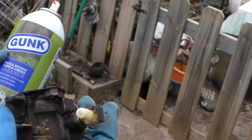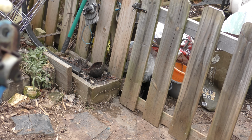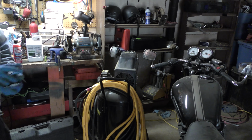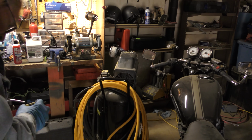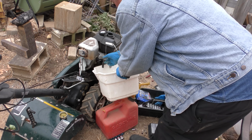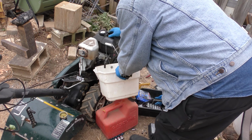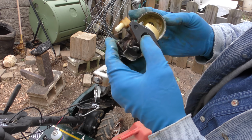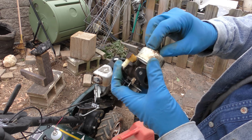That's where carburetor cleaner comes in handy. All the stinking little holes. We'll turn on a big old air compressor. A little more cleaner in. I'll do the small one. But what the heck, while we're at it, we'll drain the fuel out too. Who knows how old it is? Wilbur agrees. Smart pig. Then we bolt the bottom back on so it doesn't leak.